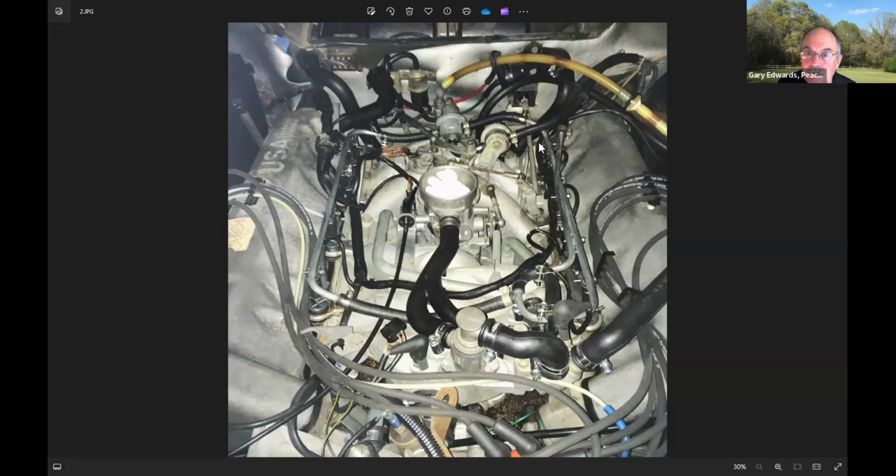And of course, you've got a fuel line that goes to every injector down in here, as well as the fuel lines that come up from the tank and that go to the pressure regulator. So there's a lot of fuel lines, and you really ought to replace every one of them when you're dealing with a car of unknown age and unknown maintenance practices. I also changed every hose clamp except for these two back here. I had a lot of what we call Yankee clamps, if you've had the Concours course, and I replaced them with the correct hose clamps.